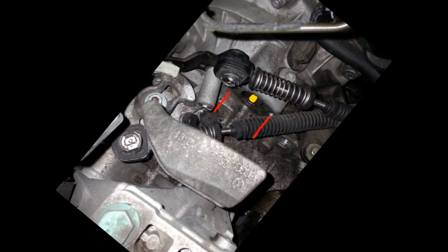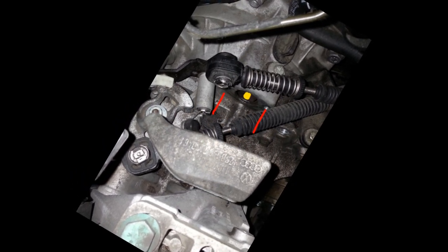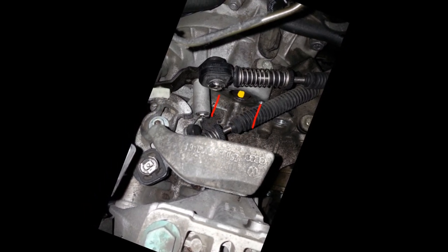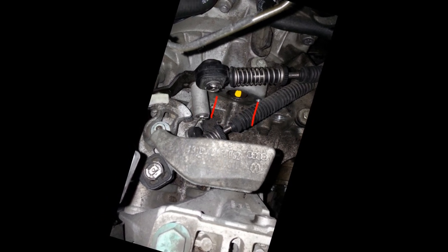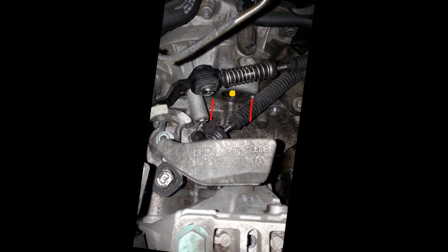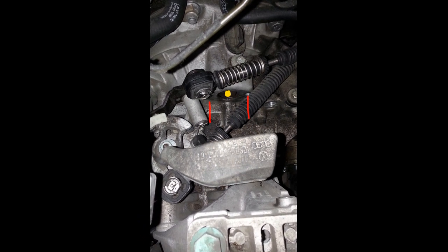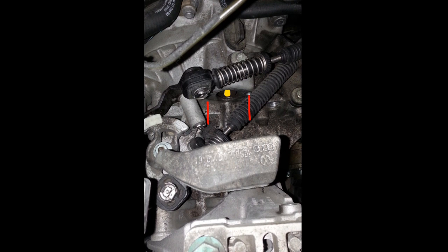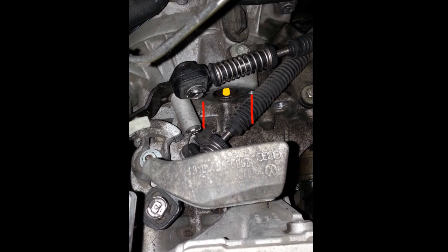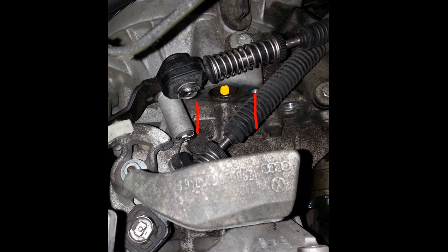Customer complaint, first of all, was that the clutch pedal seemed to feel a little bit softer than normal, but still not spongy, still solid enough to not think of it being a hydraulic problem. But the customer is able to shift into gear with the engine off, but as soon as you start the engine, even with the foot on the clutch pedal down to the floor, the vehicle will want to move, indicating some kind of binding of something, or a clutch grabbing already.